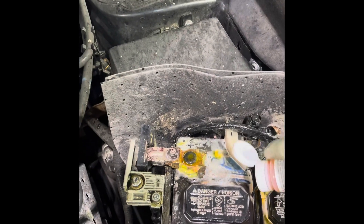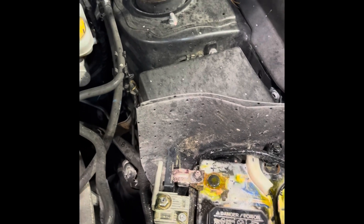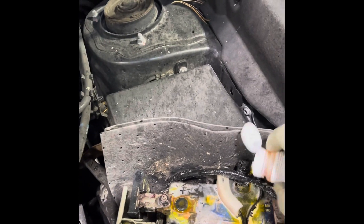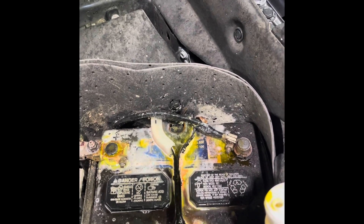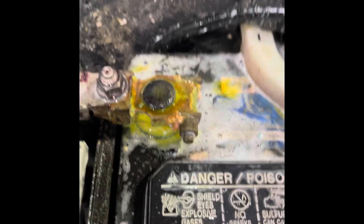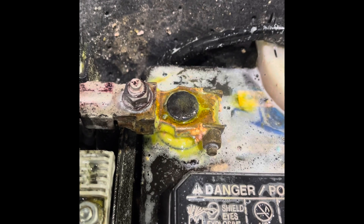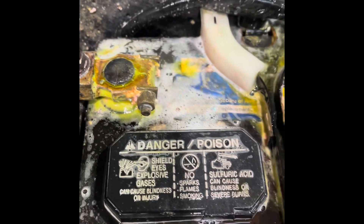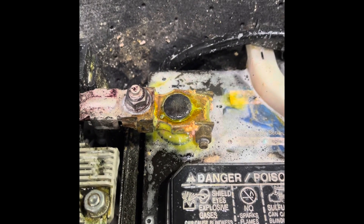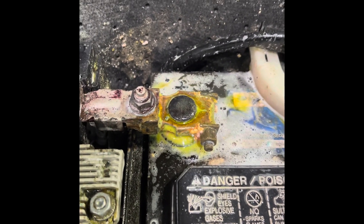We're going to add a little bit of the cleaner to all the surfaces showing signs of corrosion. This is what the terminal looks like with just one cleaning pass — remember it was nice and fuzzy before. We're also going to have to disconnect each terminal and clean the green crusties out of each terminal.